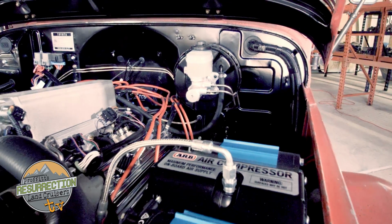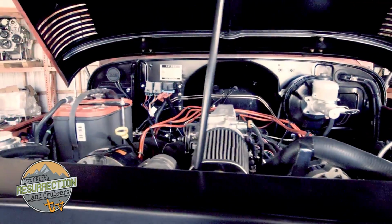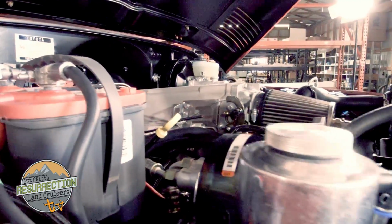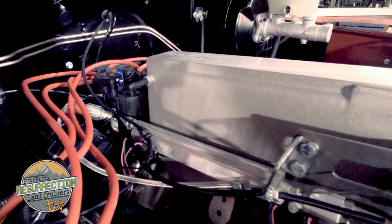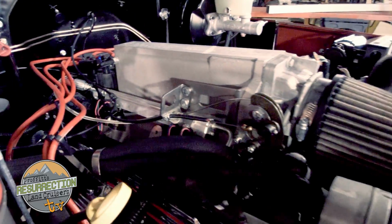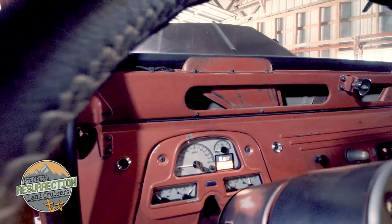So the customer wanted this to be highway drivable, so we decided to go with a GM Ramjet 350. I like the Ramjet for this vehicle because it's not covered with plastic like more modern V8s, and it looks a little bit older. Behind the Ramjet, we ran a 4L80E automatic back to an Orion 4-to-1 transfer case for the off-road ability of its 4-to-1 gears. In addition to the Ramjet for power, we added some creature comforts like air conditioning and cruise control to the drivability package.